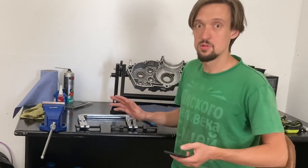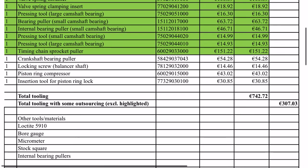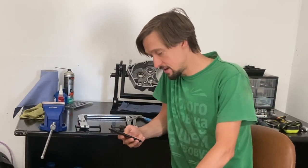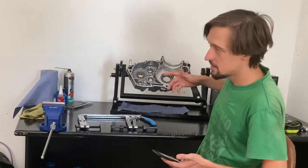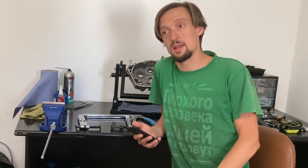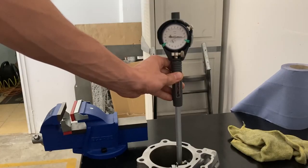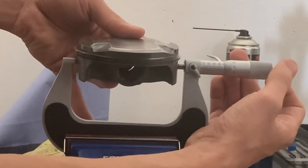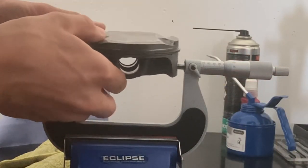There are a few other items I listed that I haven't priced out because they're not KTM-specific and are optional. Loctite 5910 is just the sealing compound you put around the engine case — not expensive, available at a hardware store or automotive shop. But the bore gauge and micrometer are expensive items just to measure the inner bore of the cylinder and the piston diameter — which I did in the video. My measurements showed they're well within spec on a 170-hour engine.